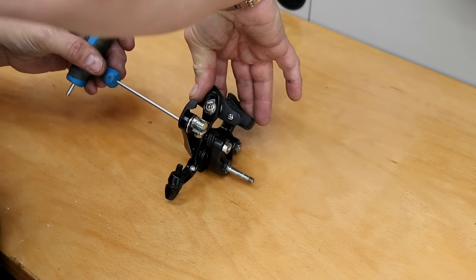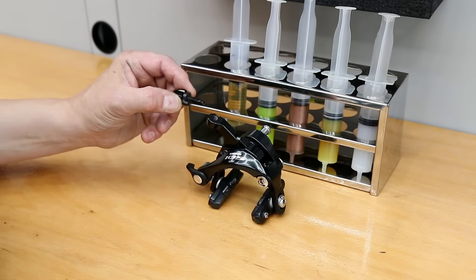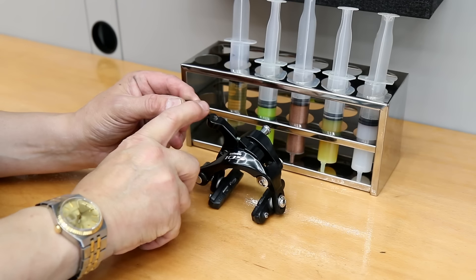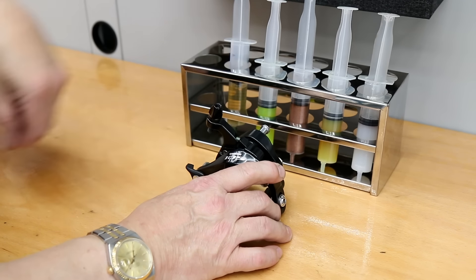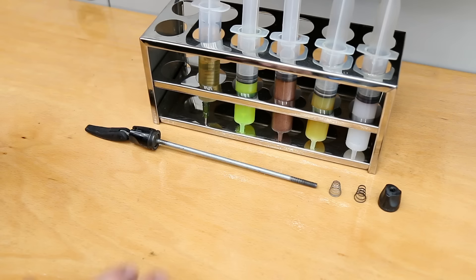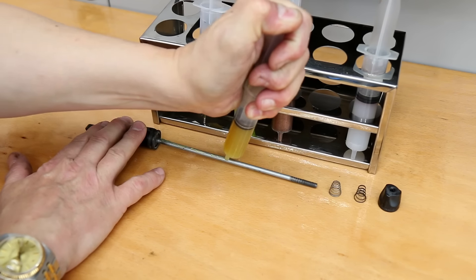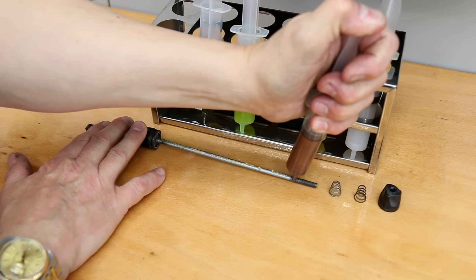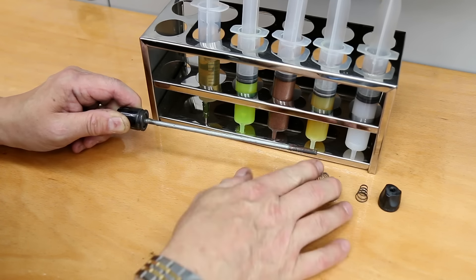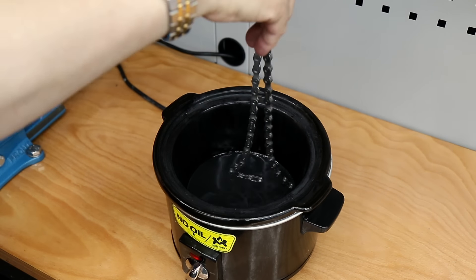Now I'm going to sort out the missing bolt on the front brake — we found a nice stainless steel matching thread bolt to lock that off, so it's now safe and secure. We've also sorted the missing safety plate on the left hand pedal arm and the missing lock nut on the front brake within this service. Then lubricating up the brake. Of course your skewers are very prone to going rusty inside your wheels, whether it's a through axle or a skewer — I've had quite a few through axles seized in wheels. If they're lubricated before they go in, that problem wouldn't happen.